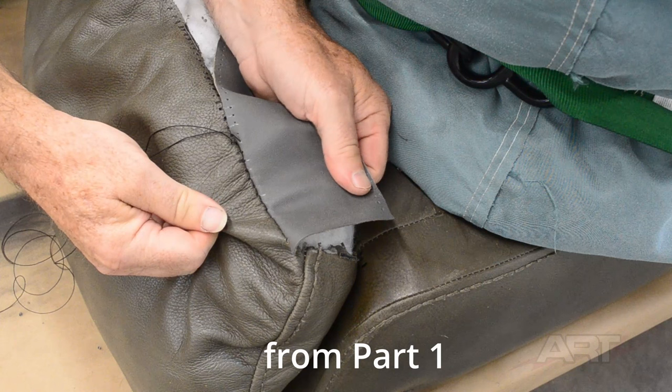So typically, the 80 stitches down one side will share the tension when you pull the piece tight. The risk on our job is that we are pulling each stitch tight, and so each individual stitch shares a good bit of the tension of the whole piece. The risk for us is that our stitching might be slightly visible because the piece is under tension as we're stitching it along. And we can find that same thing in any seam that's under high tension. So we can mitigate that somewhat by compressing the foam cushion as we sew along as much as possible.